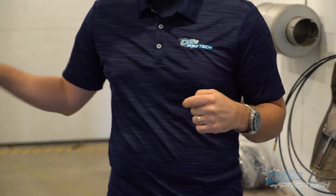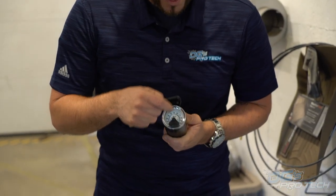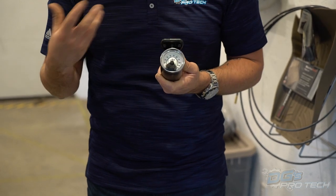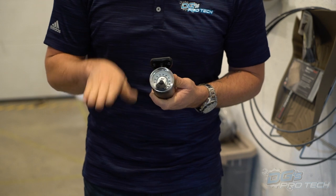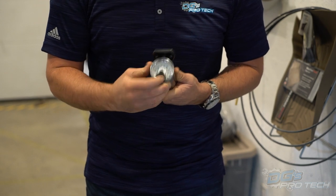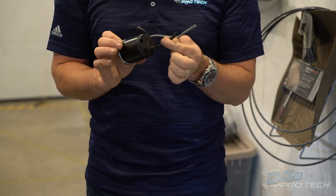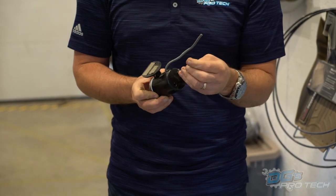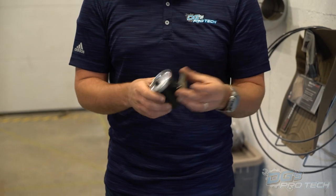This is your old-school load controller - they've been around with Airlift and competitors for years. A gauge is installed, a compressor is installed somewhere external to the vehicle, up goes up and the gauge comes up, let off your button and you've got the pressure or height you need, down goes down, and you can control left and right. The downside is we actually have to plumb this gauge with an actual airline into the vehicle - a lot more installation, and you need a good spot to mount the unit. Pro: it's cheap, reliable, and mechanical.